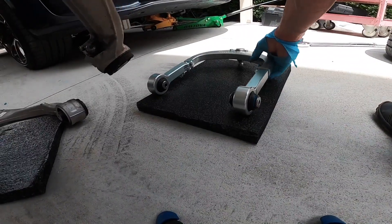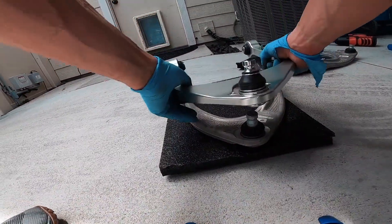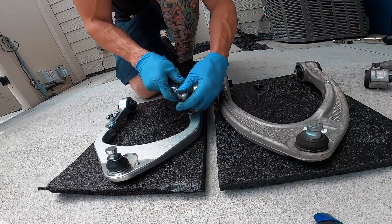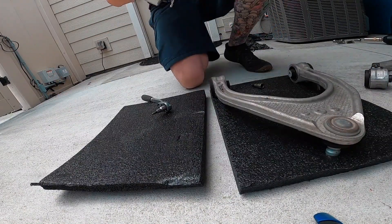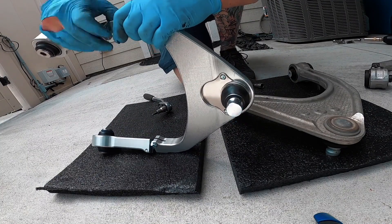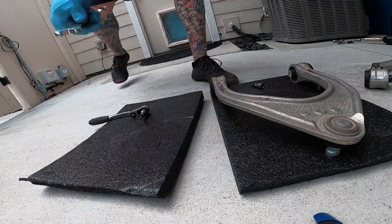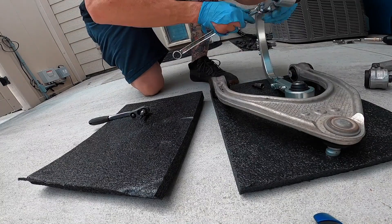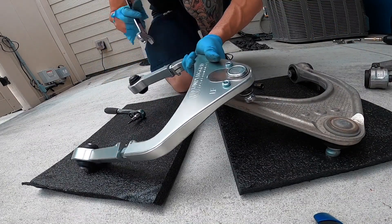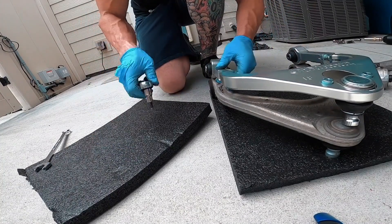Now we have to eyeball these — let's put them side by side. The rear one was significantly longer, so let's go side by side like so. This one needs to come out, and it's reverse thread on one versus the other, so you can literally turn this little nut in the middle and it'll telescope both sides out. This is a 19. This is as close as it's going to get for now — tighten these up.